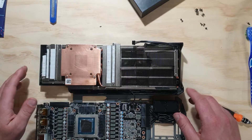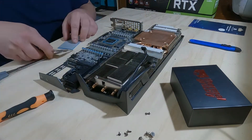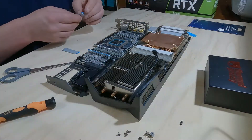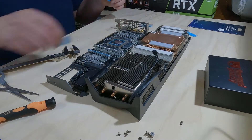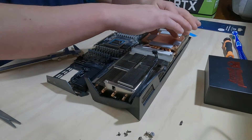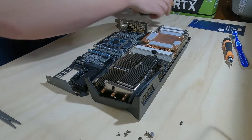What I'm going to do next is cut up the thermal pads, get them to the correct size, get them on the heatsink, and then concentrate on doing the thermal paste. The thermal pads are now on the heatsink. So now we're going to be doing the thermal paste for the GPU processor — this is the Thermal Grizzly Cryonaut Extreme.